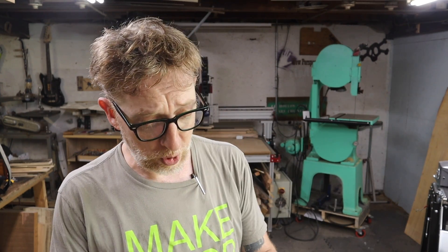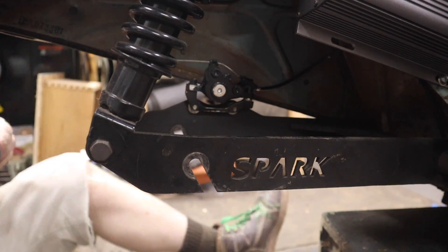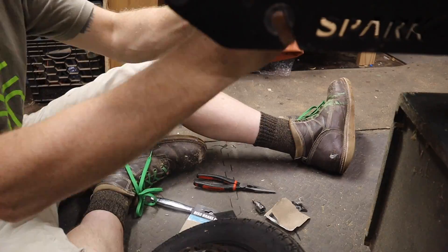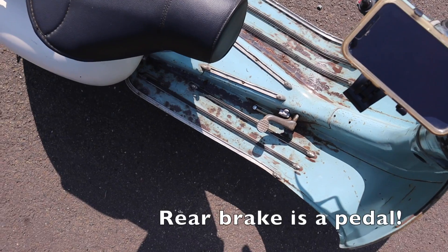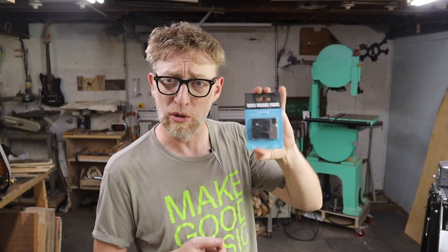The first thing I noticed about this bike is it is heavy. So I've burned through brakes already in one season. The brake pads are a little small for a vehicle that size, but fortunately they're inexpensive — I got four packs of them for $15 on eBay, and it took me about 20 to 30 minutes to swap them out. Not a big deal. The vehicle has the original drum brake in the front, and then on the rear we put a more modern disc brake. The disc brake is connected to the rear brake light, and that's the one that gets used most of the time. Definitely keep those pads fresh so you can stop in an emergency.